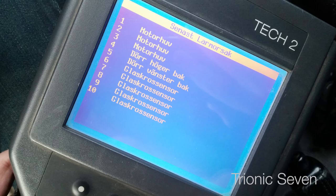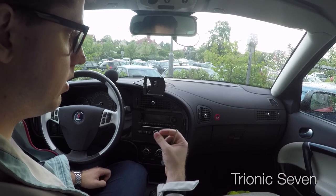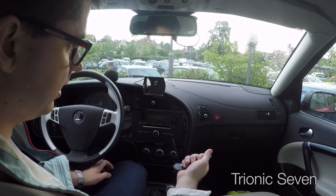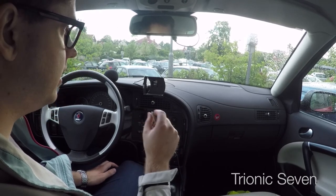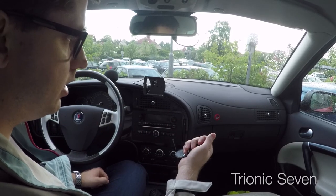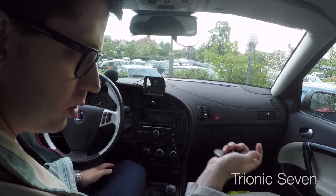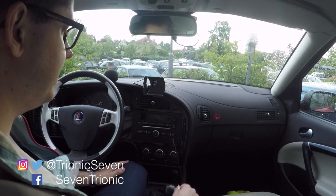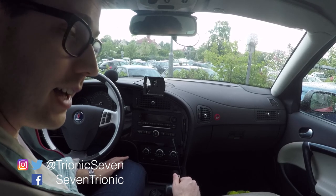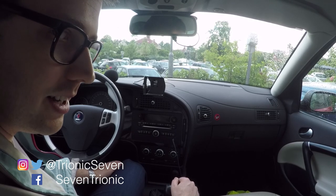Go to the Tech 2 tool and select the most recent alarm list - it will tell you the reason why the alarm was triggered the last 10 or 15 times. Try triggering the alarm yourself by opening the hood and closing it, then wait a few days. If the alarm triggers again, check the alarm list to see if there's a reason it went off in the middle of the night. If the last alarm logged is just the hood you opened, then you know it's the alarm siren that is bad. If you see a sensor like the front right door, then it's probably that door sensor going bad. I hope this was useful - please leave your comments and questions below, and I'll see you in the next Saab video.